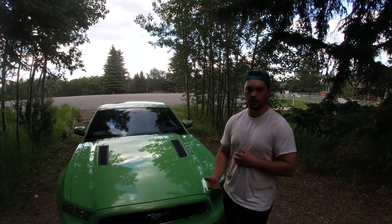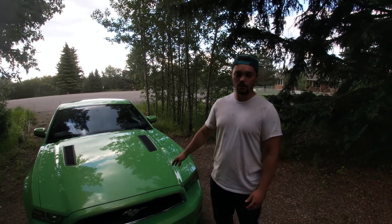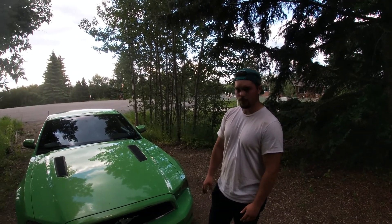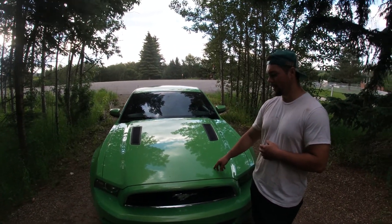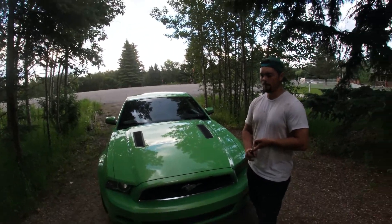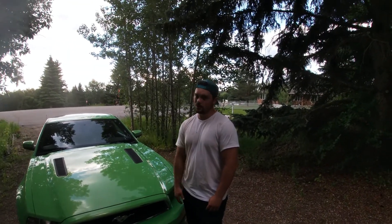The Coyote — when it came out that was the first year they really put it out in the cars. It didn't have any recall problems or anything like that; it's not a junk motor, which is also good — the Tritons were pretty bad. If you're looking for one, I highly suggest the 2013 to 2014 years. The tunability on it is great too. In my opinion the LS is still a better engine, but if I were to build a new motor I'd build a five-liter Coyote because I think they sound better. If I was going for 1200 horsepower, reliable — LS all day. But if I was going for a nice 800 horsepower build, I'd choose the five-liter.